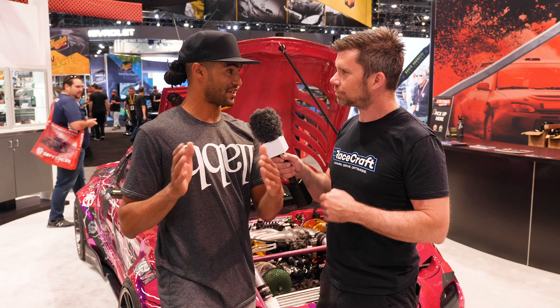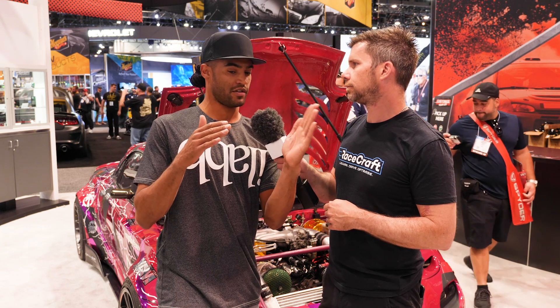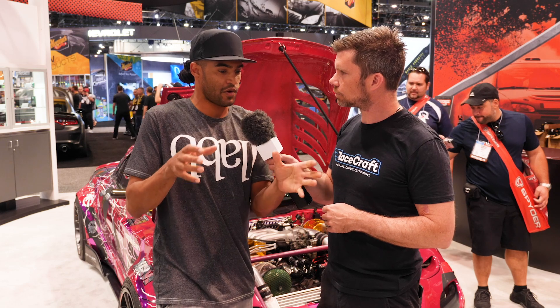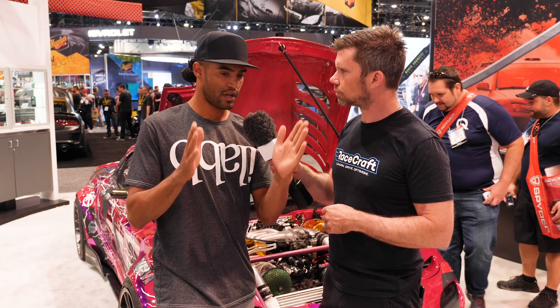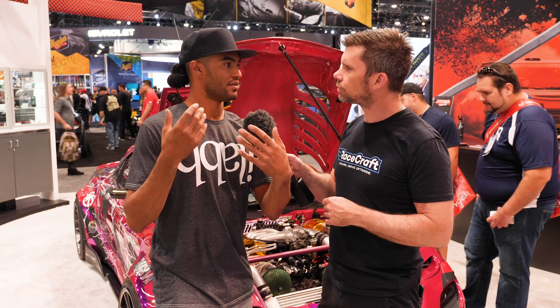The wide track is more than just bolting on a wide wheel with a massive offset, because that affects your scrub radius, which can be negative. There's a lot of misconception about Ackerman but technically in drift, we've done everything to prevent the leading wheel from scrubbing, because it creates a floaty sensation that's very unpredictable. So we put the scrub on the rear trailing wheel, and that actually helps stabilise the car to make it easier to drive.